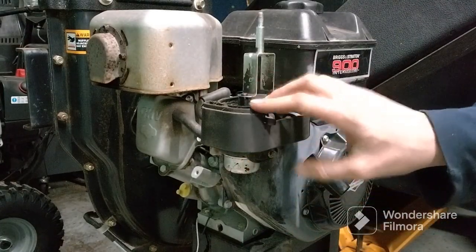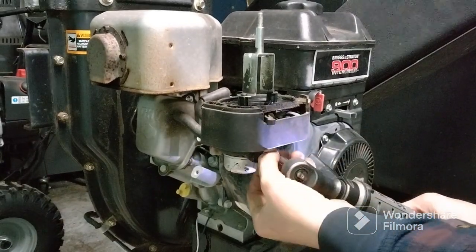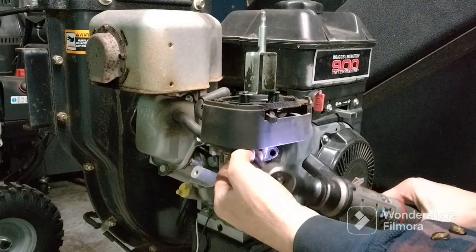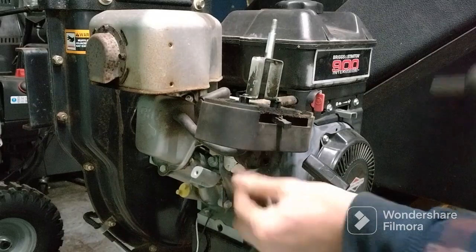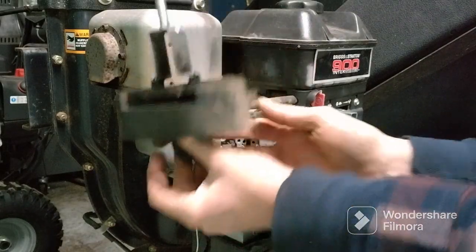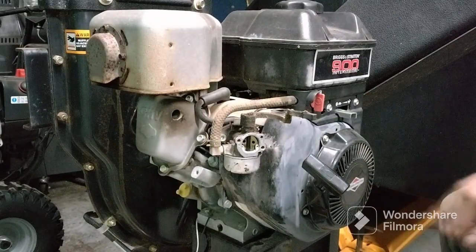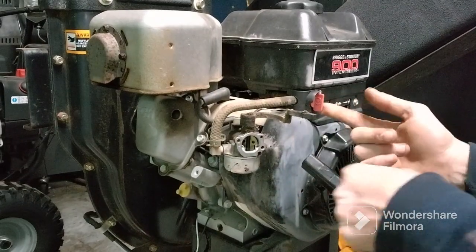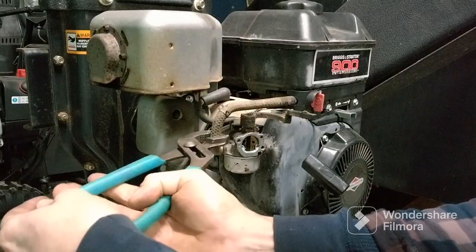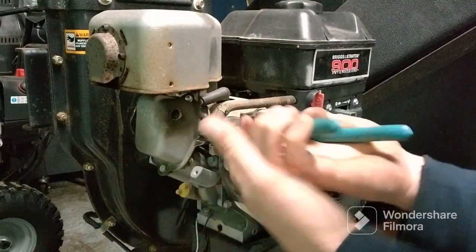We're gonna be taking these two bolts off right here to take this off — it's a 5/16 socket. That vacuum hose is kind of in my way to take that bolt out, but no big deal, I'll just let everything hang there. This one's got a shutoff, so I already got the gas shut off. I'm gonna take the gas line off and twist the line to break the seal — it helps a lot. Normally you don't break your gas lines that way, otherwise you have to change them all.